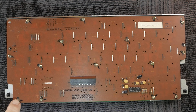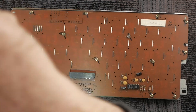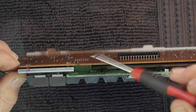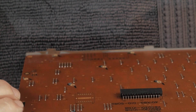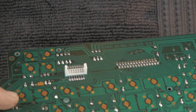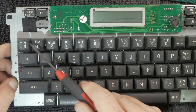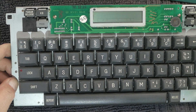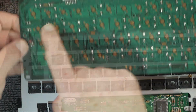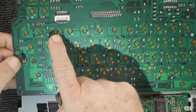Next, there are all these screws — usually sealed with some kind of adhesive. I'm going to take all those screws out. All of these screws were the same kind. Now between the circuit board and the keyboard is a white connector; just put a thin screwdriver in there and pry the connector off — it has pins that fit into the socket. So this is our number five key, the one giving us trouble — the sixth key over from the left on the top row, and it corresponds to this row on the circuit board.